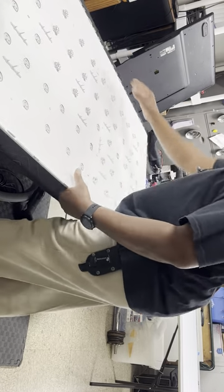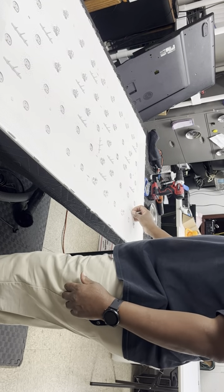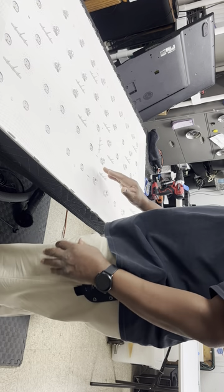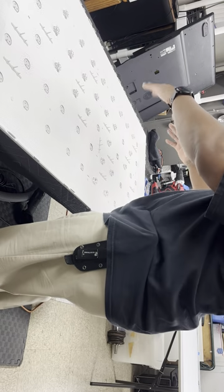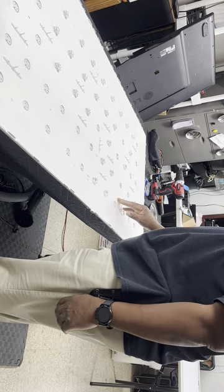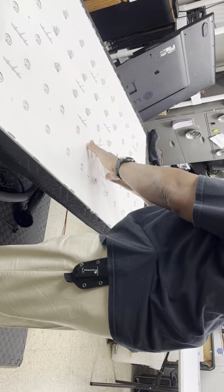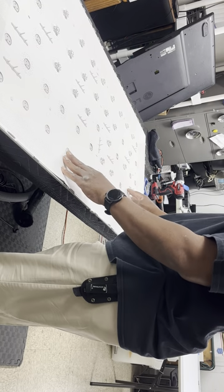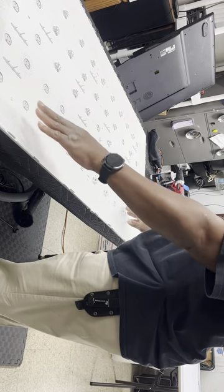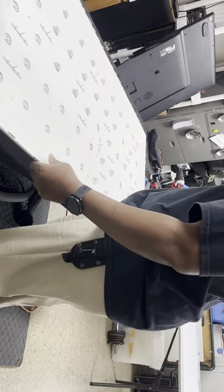So anyway, you got some plastic offsets that support the back of the screen. You got to take them off. I usually don't take them all off. I'll take them off so I can do one half and then take the other half off. So I see there's a row right down here in the middle, four in the middle, and then there's three right here. There's actually five through this middle. So that's five of them I can actually leave. I'm gonna take them four off, them three off, and then these three off, and I'll flip the sheet over, change this side, then flip the sheet over this way and change that side.